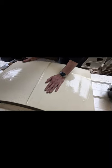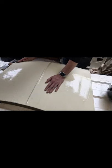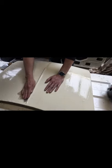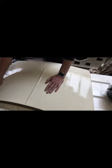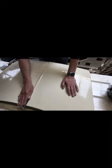You can just go over it, repaint it. As I said in the forums, I was quoted £4,000 to £8,000 to respray it — in two-pack, which in my opinion doesn't look right. It's too bright. This gives it depth, like the old cellulose, like it should be. And for £350 it's worth the effort. And the paint you have left over — if somebody scratches it or dings it in a car park, instead of sending it to a garage costing hundreds and hundreds of pounds, you can do it yourself. A panel like this will cost about £15, maybe less, because you'll have paint left over.